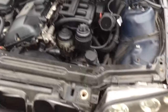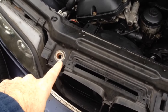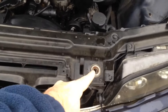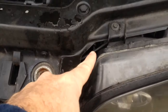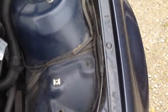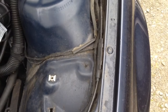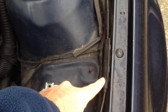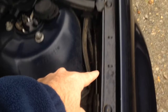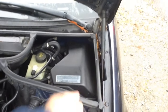So we actually have three cables in the system. We have a short cable that runs from this latch on the passenger side, that runs under this metal radiator support to this latch. We have another cable that runs out of here — you can see it right there — and it runs up to this little junction box. This junction box actually comes open. It goes into that junction box with a lead slug, it has a little thing that hooks them together, and then it runs up into the car to the kick panel with the latch you pull to open the hood.